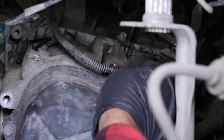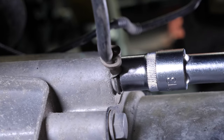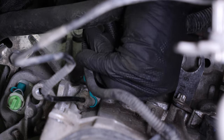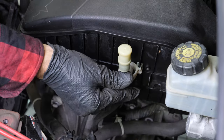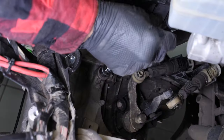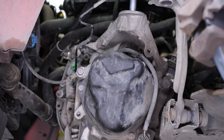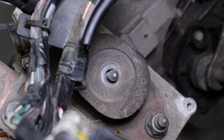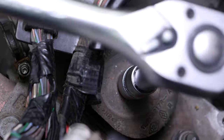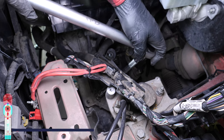Reconnect the reverse sensor connector. Clip the sensor sleeve back onto the gearbox. Screw the grounding screw back into the engine block. Reconnect the breather. Screw the gearbox bracket back onto the gearbox. Using the jack, raise the engine block and pass the vertical screw of the gearbox bracket through the gearbox buffer, then screw the nut back on. Finish off the tightening with a torque wrench. Finish tightening the three screws using the torque wrench. Remove the jack.